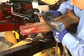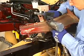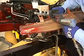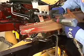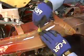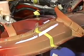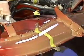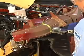Before removing the frame rail, a radiator core support fit will be checked. Because of the build sequence and part geometry, this requires removal of the front half of one outer upper rail. After drilling out the spot welds, the sectioning cut line is marked and tabs are inserted to protect the inner upper rail when the cuts are made. The cut is made and the part is removed.